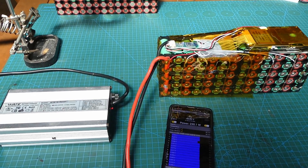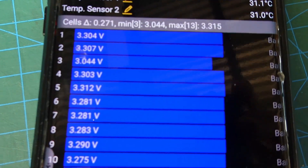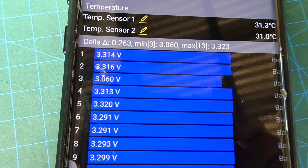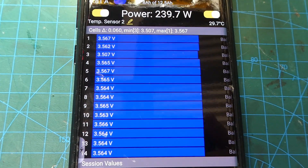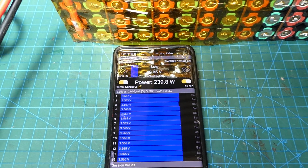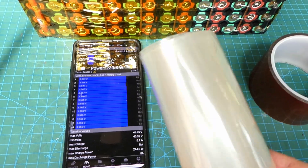I've got the battery charging now. You can see already that the cell where the fuse wire was broken — before I soldered it, that bank was at 2.7 volts, now it's at 3. The cells have all balanced out now — the lowest row of cells is 3.5, the rest are around 3.56, so I'm going to call that successful. I'll get it wrapped up with Kapton tape and a new sleeve of heat shrink.